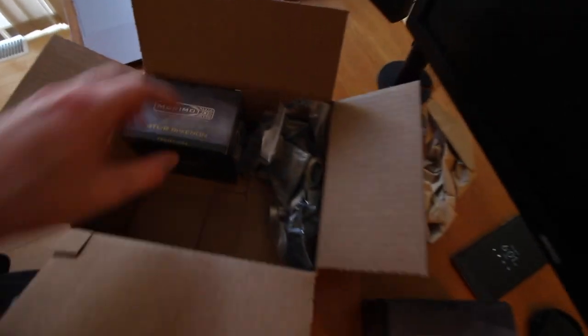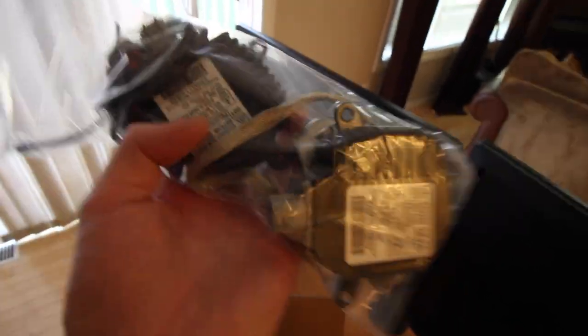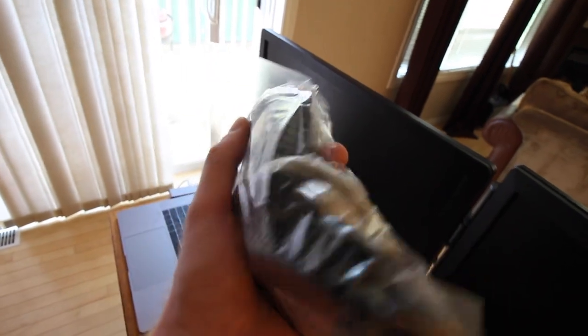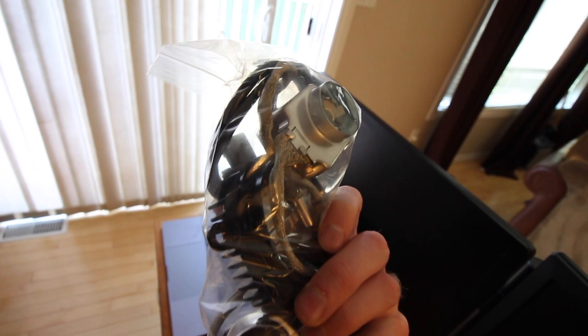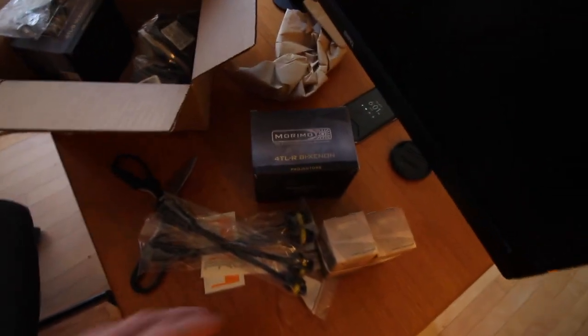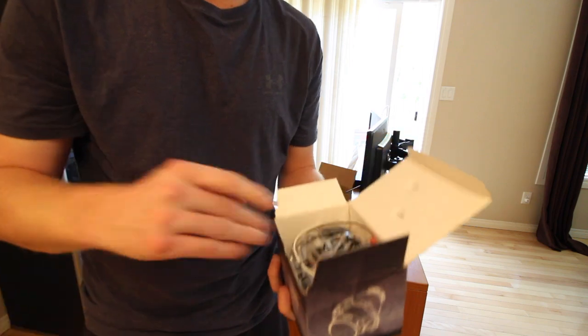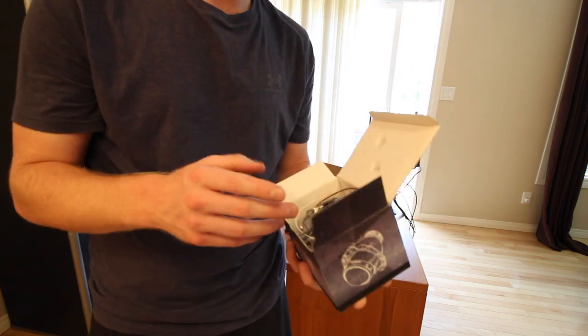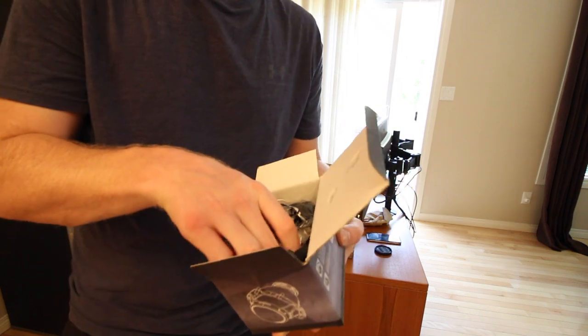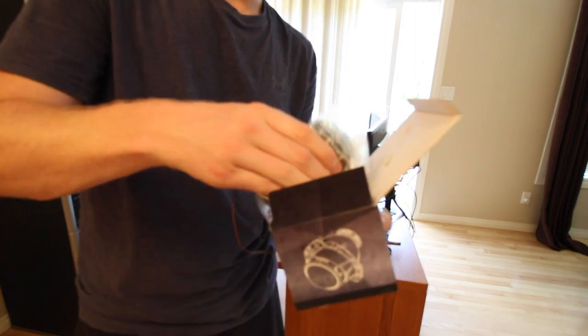So I figured spend half the price and get almost the same quality. Then we've got the other projector in here, and this is the mounting hardware for the Subaru. Here we've also got a couple of new ballasts — these are actually the main parts that I needed. These are what will make my headlights stay on. As I mentioned, my ballasts were done and my headlights would flicker out after like two minutes of having them on, so that was getting to be a really big headache. Let me go ahead and open up one of these projectors just to show you what it looks like.